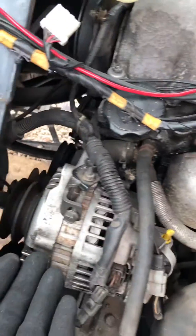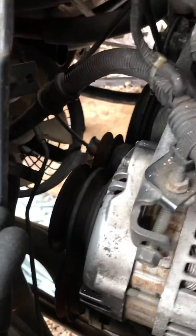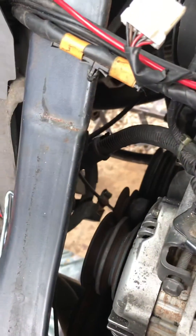This is the passenger side. On the 2.5 engine, all the belts are here. Some people don't take the top off and manage to do it, working their way through on both sides or underneath. It's handy to have the bottom panel off so you can get to underneath. You'll be turning the crankshaft to turn the engine, which is that huge big bottom pulley.